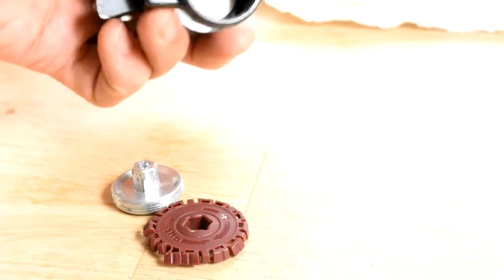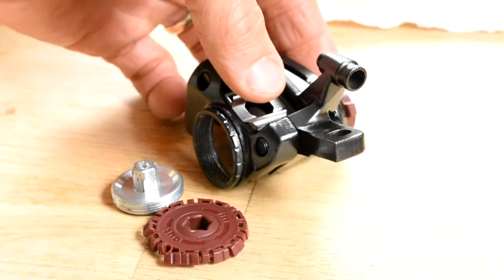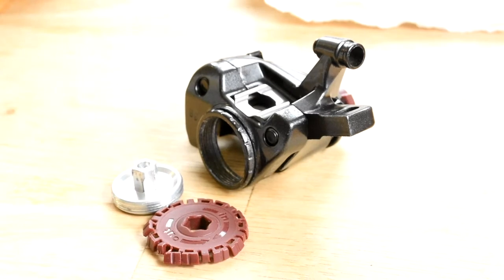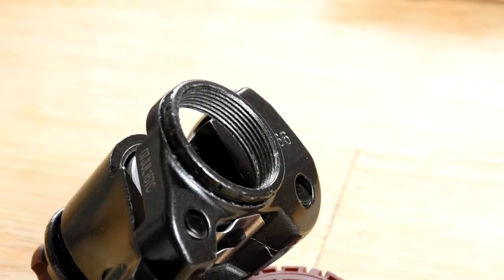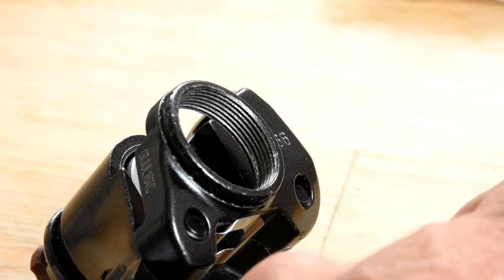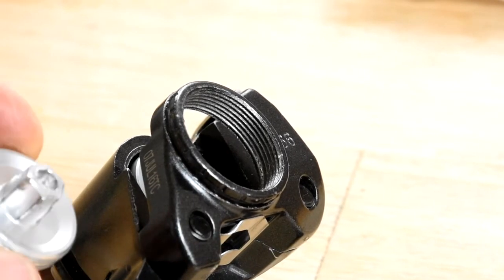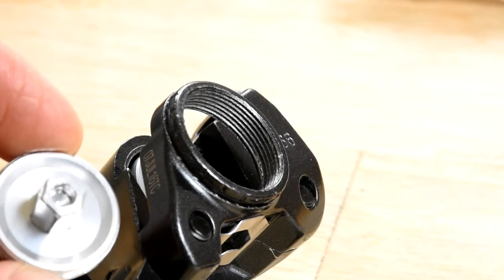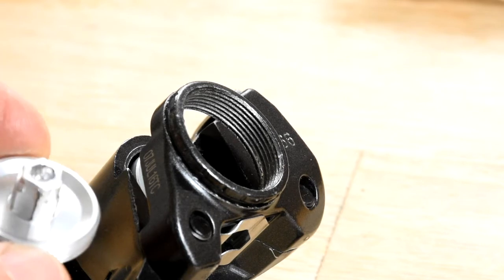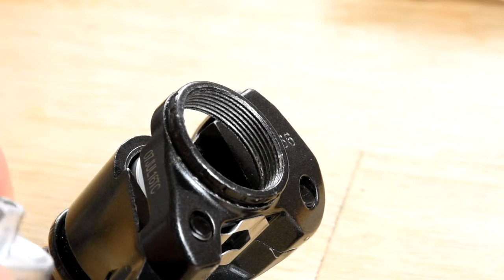If you recall from the previous video, the adjustment knob for the inner pad, I was not able to turn it, and cracking it open, it's pretty obvious why. So I opened it up, I took the little red plastic knob off, and had to use a wrench to get the inner pad adjuster off. It was seized, it wouldn't move. I actually needed to put a socket wrench on the end there to get that off because it wouldn't turn at all.